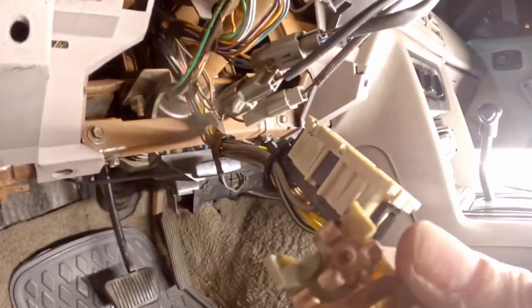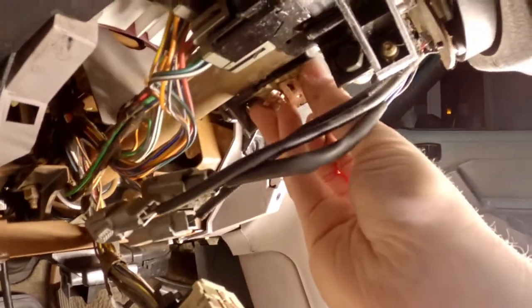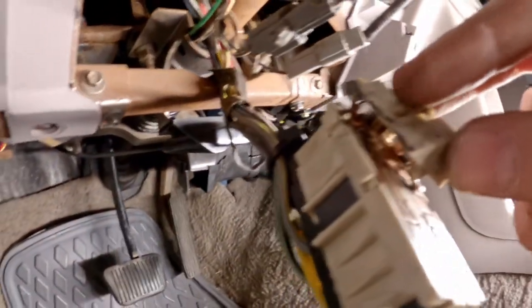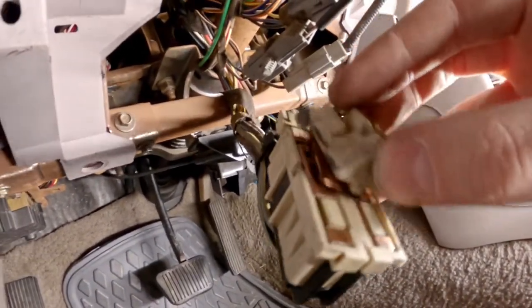Looking at this piece, you have two parts. You have this piece right here which stays up inside of the lock cylinder. When you turn the key, it moves this piece and it moves the contacts on the bottom part, and that's what turns the ignition on and off. So if this piece isn't making good contact with the bottom piece, then you might have issues activating your turn signal switch.